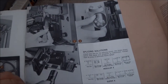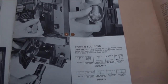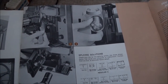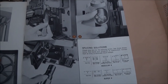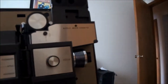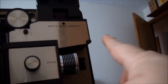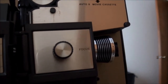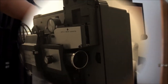Let me point something out — they don't show it in the manual, but for some reason if your film doesn't auto-thread and you can't figure out why and you've checked the whole film run and don't see any problems, remove those two thumb screws and look to see if you've got a film jam in there, or broken film not attached to anything.